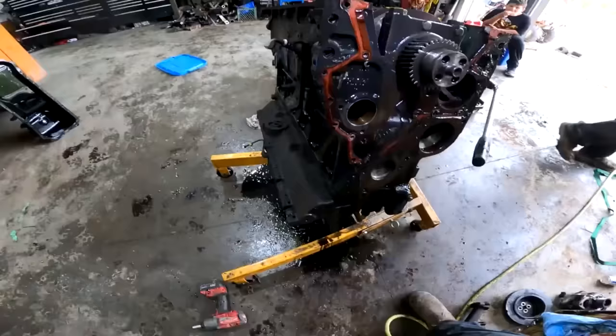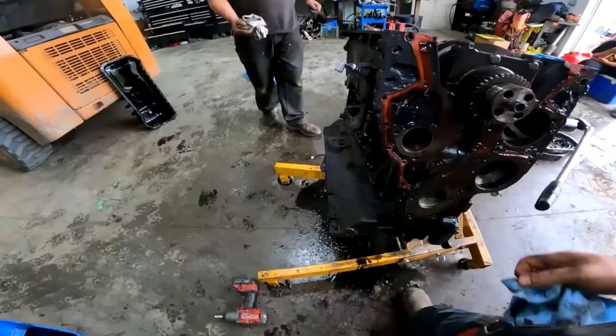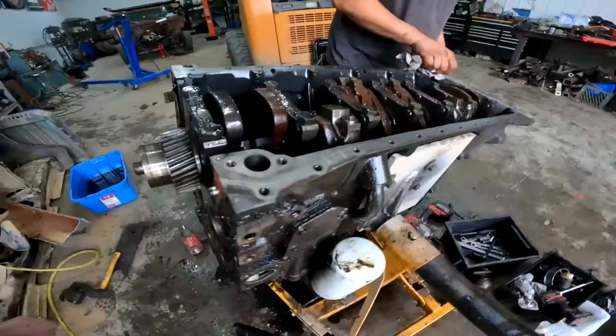All right, but yeah, we got to do this timing gasket seal thing because it was blown right out, so that's going to leak all over the track. This drag racing thing is already kind of a drag, you're not allowed to have leaking stuff, but the mud bog just mixes in with the water and it's fine. But this, you got to make sure she's sealed up. So get the front gasket, main gasket, and you got to pull the whole mill down, upside down, and do all the stuff, so we're going to keep at her.